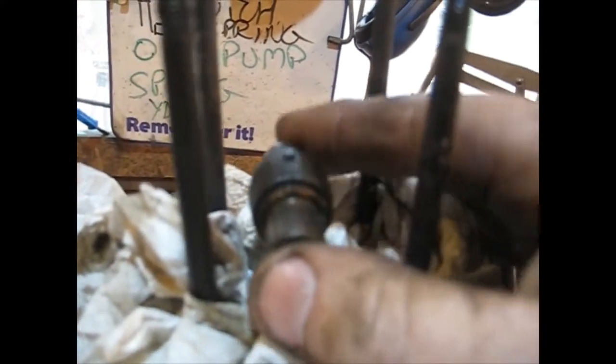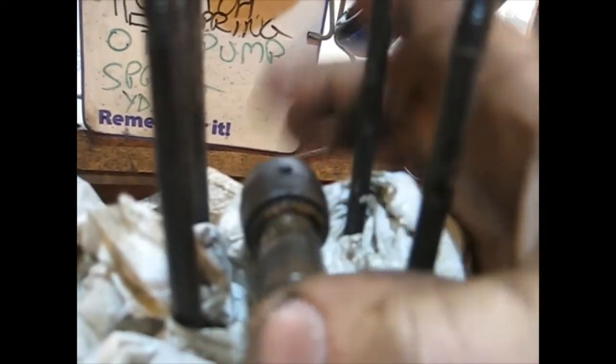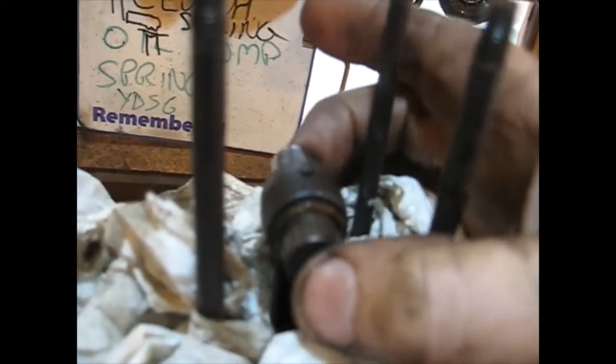Okay, got the piston off. It's not the piston that's worn, it's the little end that's worn. Look at that. It's like a bronze bushing here, and that's gone. That's been the problem. The little end's gone. Might be because they've not run enough oil in it or something. And then it's broke a piston ring, and that's been end of story.